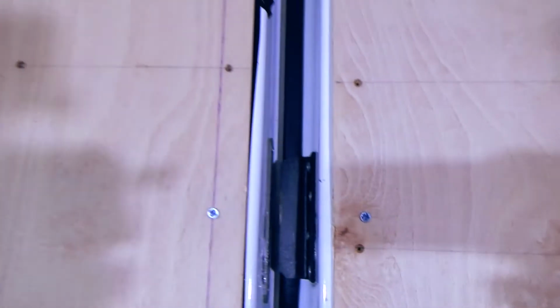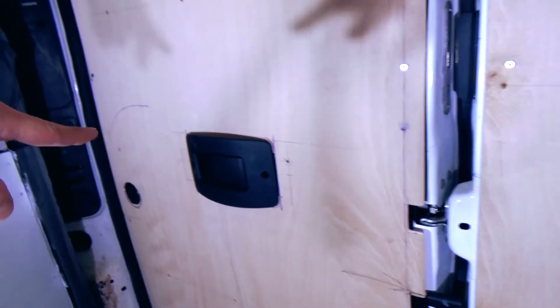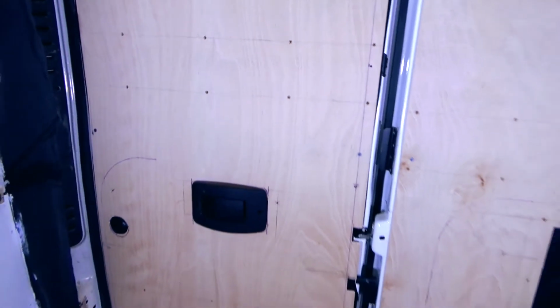I'm going to be putting a layer of Celotex behind this. Temporarily it's screwed in. I'm going to drill them bigger and put in M6 riv nuts. And the door handle, they're M6 bolts on there, so I'll just get longer M6 bolts. Just enough slack on the cable behind. My advice to you is buy these ready-made. If you've got 8+ hours to dick around, because I ain't finished with them yet, because I've still got to repair all these holes. I'll show you my pump.